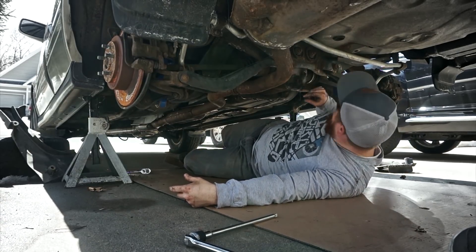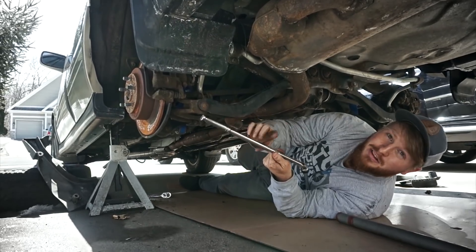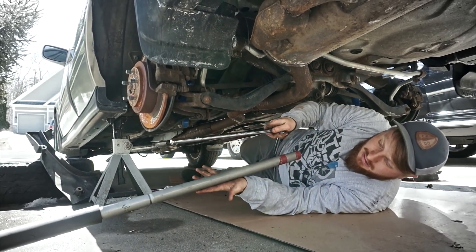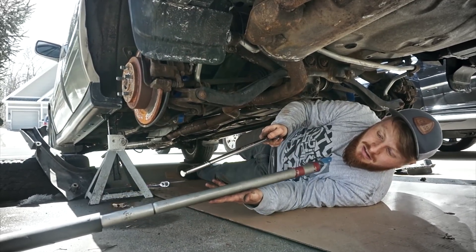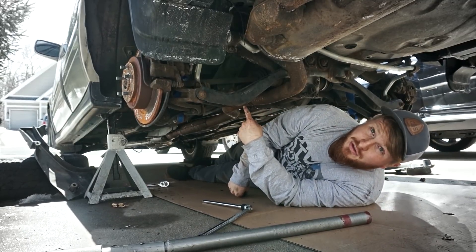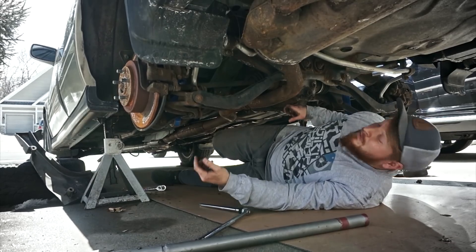I'm upgrading to what's in a Ford Explorer and using the Ford Explorer axles. The Subaru axles are about this big - a little bit bigger in diameter - and the Explorer axles literally are this big. There's no way they're gonna break. And I can get Explorer axles at the junkyard for $17. If I was to buy upgraded Subaru axles they're like $400 for two, and it would still be questionable if they'd take the power, plus you'd still have the limiting factor of the differential.